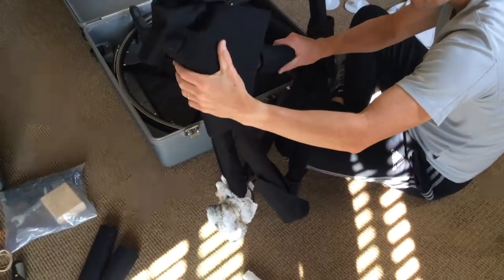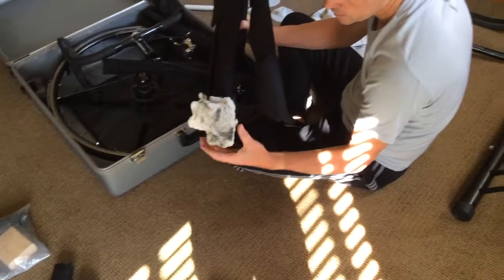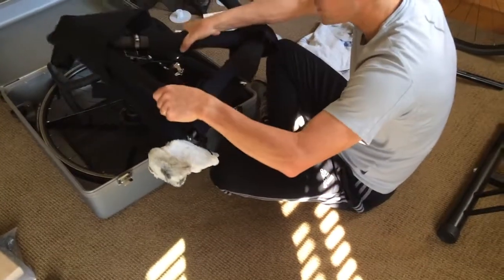The crank's out of here — we'll show you putting that in. Because I pack the derailleur downward in this case, I go ahead and put a rag around here and just rubber band the rag on there so it stays. It just protects the surface of the derailleur, because it's going to be facing down.